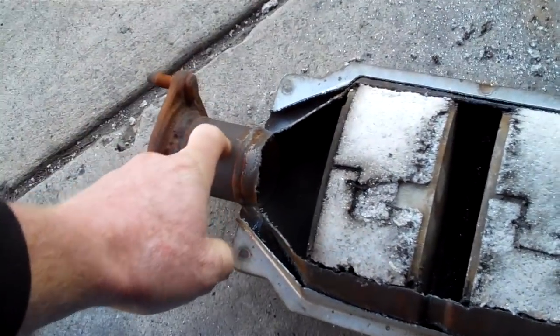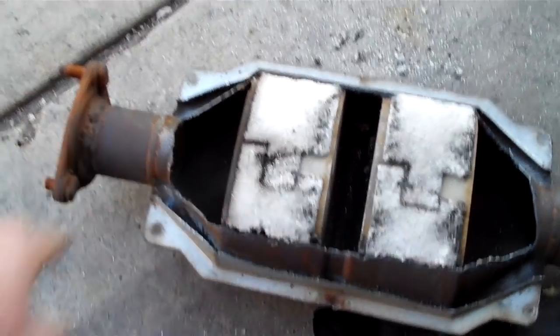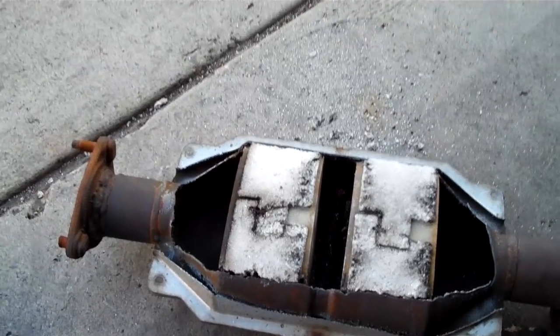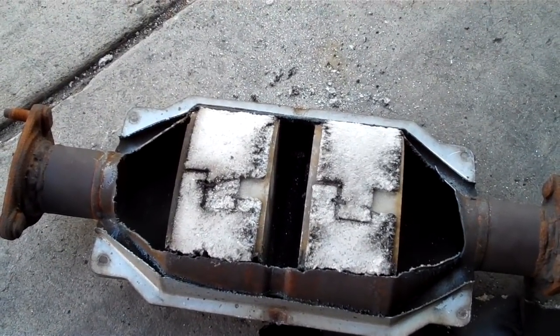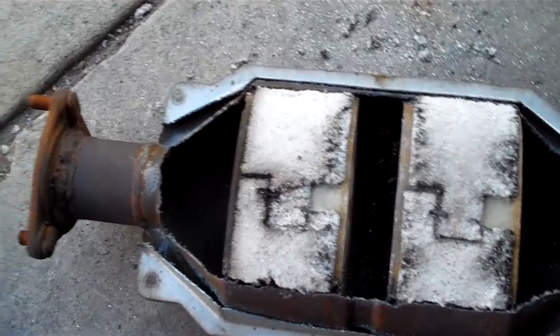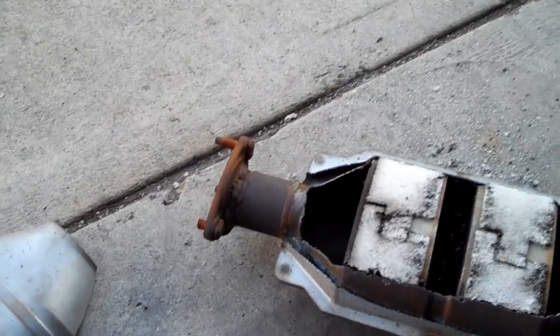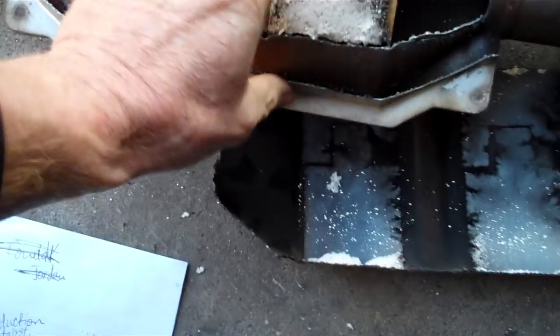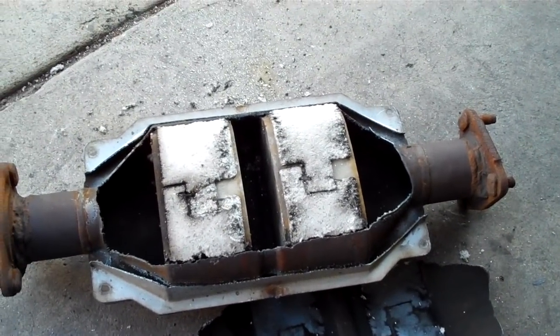You've got an air-fuel meter — it just senses oxygen. If you have a lot of oxygen up here, that means it's not being burned in the combustion cycle. You're supposed to have H2O, CO2, hydrogen, and just nitrogen passing through — plus nitrogen and argon from the air anyway. If you have a lot of oxygen, that means it's not burning properly, so your sensor will say we're either too rich or too lean, and make adjustments. Then you've got another sensor in or after the catalytic converter that basically babysits to see if you've burned off everything or if you're polluting.